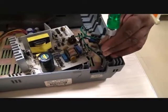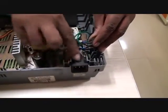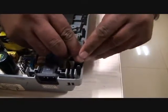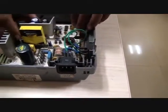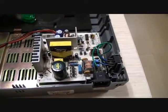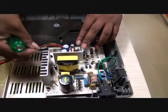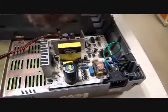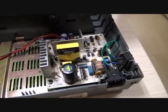This is a very important screw which we should not miss when we are inside and when we are replacing the power supply. This is the AC inlet and this is the power switch which goes in this slot. This particular unit sits on four screws — again a self-threaded screw which goes on the plastic part, making it easier. Then this is the machine screw which goes here.